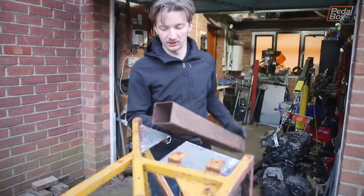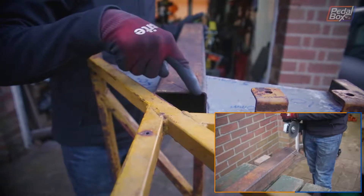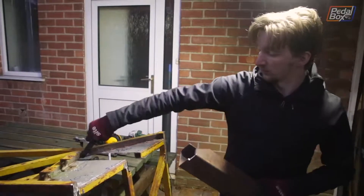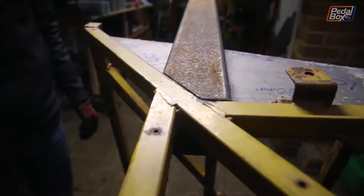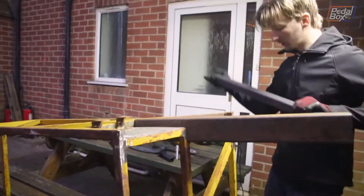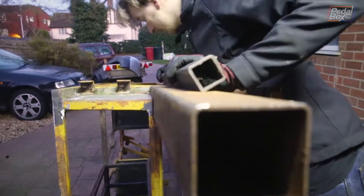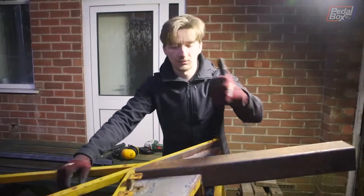So we've done a lot of cutting, a lot of refining, and this fits in perfectly. What we're going to do now is take the piece of plate that we cut out of here, template it on the side, and cut this corner off — it should butt nicely up into the gap there. So we've cut the end off, notched it nicely, and we've got a little divot there to sit around the frame and secure it on the front. Let's drop this in — and there we go. Just to make sure we've got it vaguely true, because the last thing we want is this popping up or tucking in. I'm just going to offer this up against it and see if we're concave or convex. That is to within about half a mil of dip — there's more bend than that in the chassis itself. So we're all set on the passenger side; we've now just got to repeat all this on the driver side. Nice and simple now that we know what we're doing — shouldn't take too long.